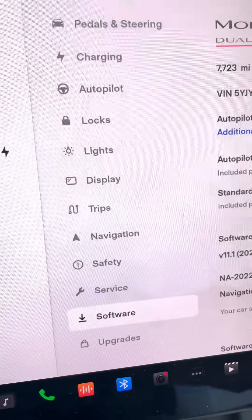That's my workaround. Go to track mode — but remember, every time you get in the car you need to enable it, as the car won't default to track mode. So: have the car in park, press the button icon on the far left bottom of the screen with the little car, then press track mode. You can customize those settings as you see fit. The settings in this video I found were pretty effective. The main thing is to reduce regen braking all the way down to zero.